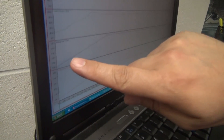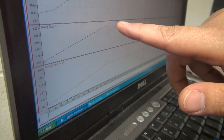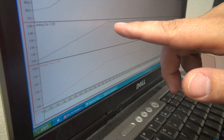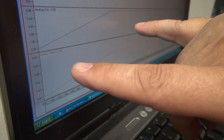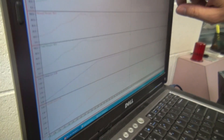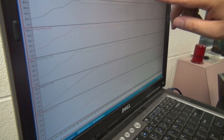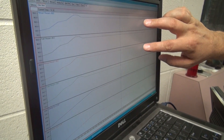The analog out is being done in graph mode, showing zero to five volts with 4.8 volts being indicative of 15 degrees of timing retard. So we're doing time-based timing retard. It could also be done proportional to the nitrous if we wanted, and then we would actually have the voltage following either nitrous one, nitrous two, or a combination of nitrous one and nitrous two.